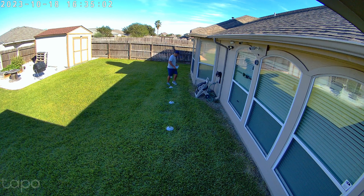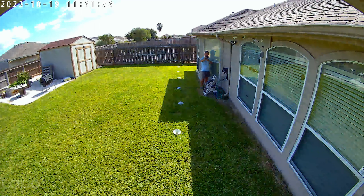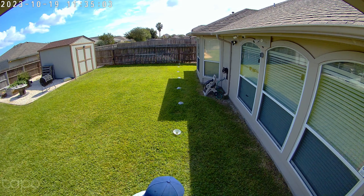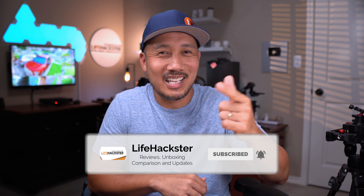So what do you think? Video quality is pretty decent in daytime. Remember also that this camera has a wide field of view. Color night vision though could be better. I like that subscription is optional, except that you will not get rich notifications or snapshot previews if you are not subscribed. Detection is a bit limited to only 20 feet, which in turn means it detects and records a bit late when motion is going towards it. AI detection though has been pretty reliable. This camera system is available at Amazon and Best Buy — I will leave links below. And that's it for this video, thanks for watching.